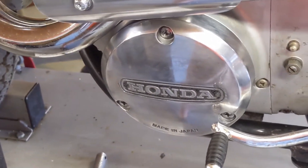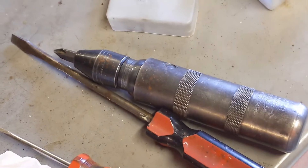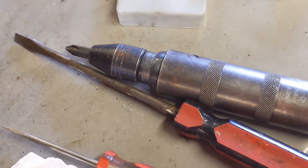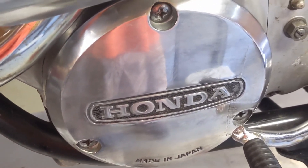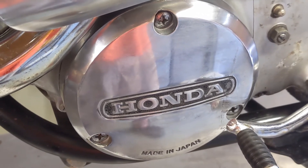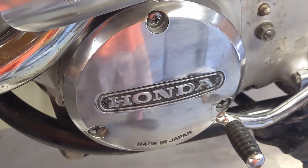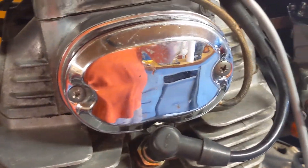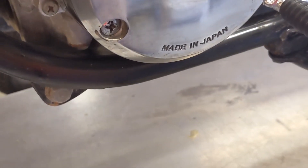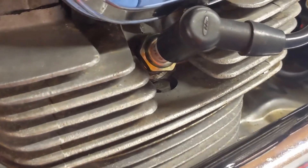I have the alternator cover back on. I used a regular Phillips head screwdriver to get the three bolts in and slightly snug, then went with the impact driver — not hammering it — just to get a little bit snugger fit. There's just a thin gasket sealing that cover; you don't want to get them so tight you can't get them off without stripping them. The hardened heads on those impact drivers fit these Phillips head bolts perfectly. Now with the points cover on, clean up the little bit of oil that drops from under the alternator cover.